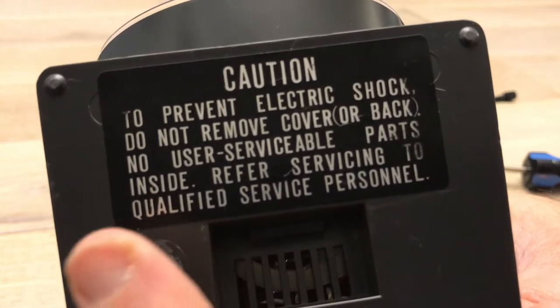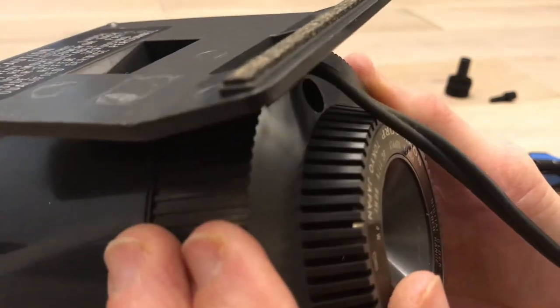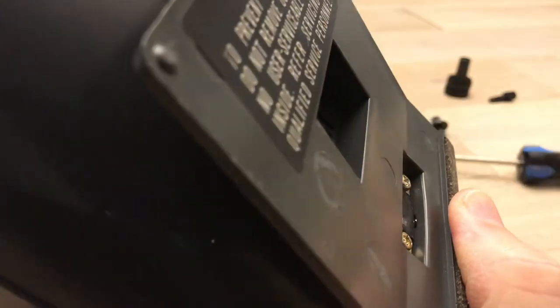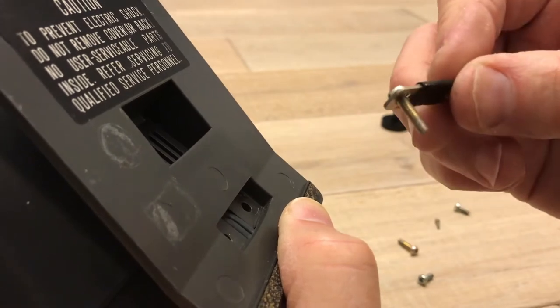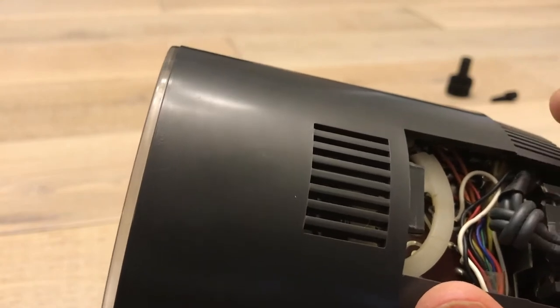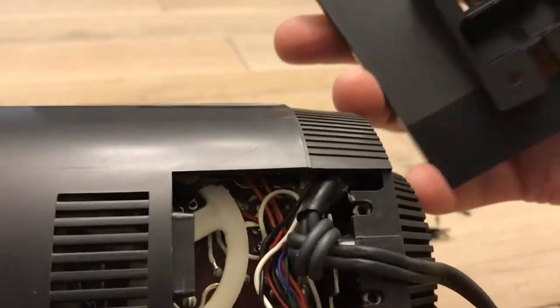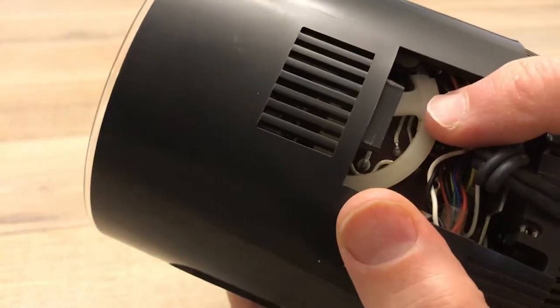This base has to come off. There's a cork piece there — sometimes that's missing on these clocks, this one's in good shape. The cord is held in place by this little piece. These two screws hold the base onto the clock body but also hold the cord down. The longer screws go in there. There's a tab — you can't just yank this off, you have to slide it forward slightly. The cord's been tied in a knot; that knot will go back in that channel when you reassemble. There's the tuner wheel — this is a clock with a stringed tuner, which can be a nightmare.